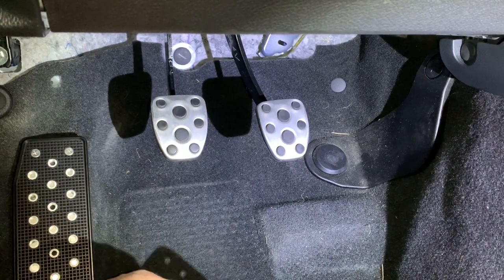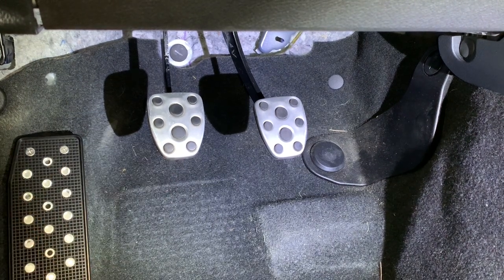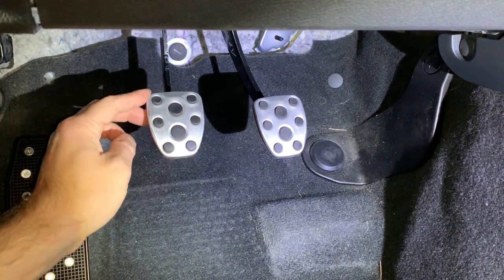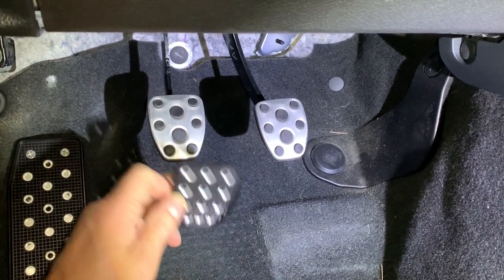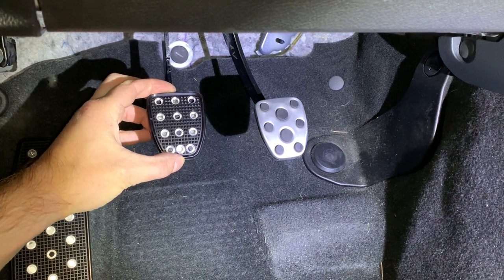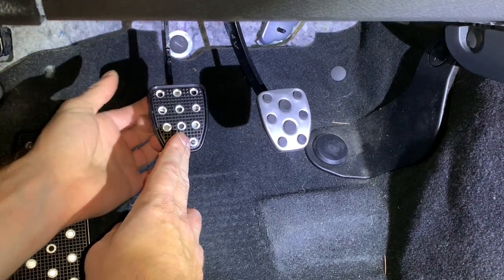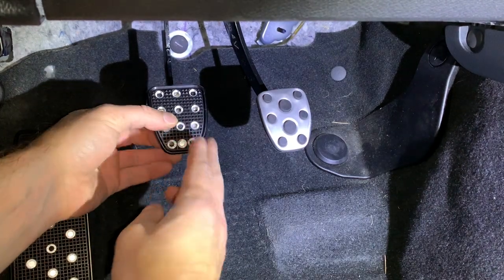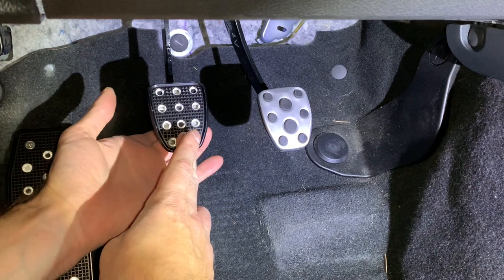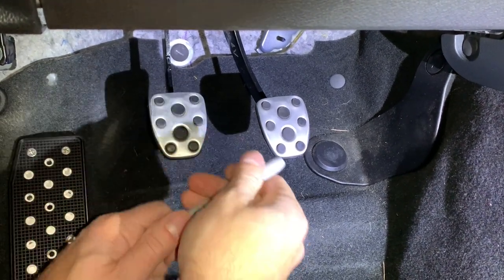Before installing the throttle back, let's go ahead and install the clutch and the brake since having it out gives us a little more space. These are a little different — the reason they use a different method is because these pedals are rubber, so rather than self-taps they want you to drill through the pedal and use a screw and lock nut in the back. They fit the actual pedal very well. One thing to note: on the top, the arm doesn't leave room to get a nut back there, so I'm going to use the middle holes where I have access on either side. I'll take a sharpie and mark those out, then drill.